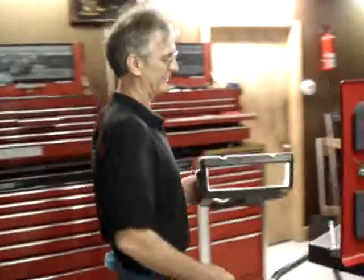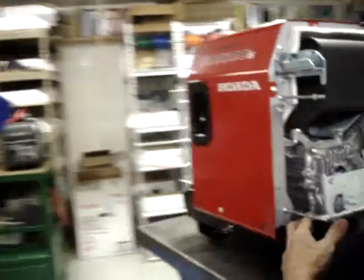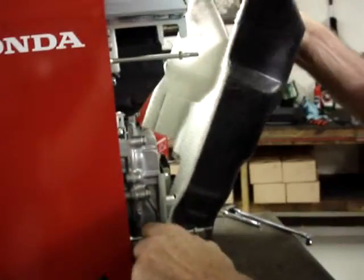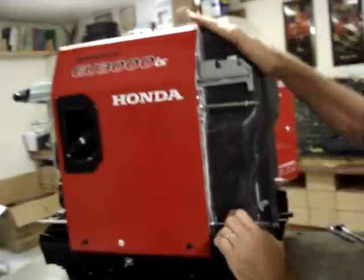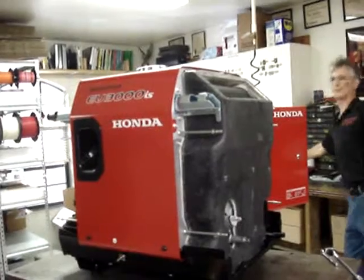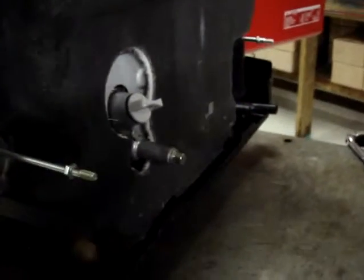The next section will be to put the cabinetry back together. As you remember, on the California model, you've got to spread the heat shield around this motor mount. On the other 48 state model, or other 49 state model, excuse me, you've got to bow both of the bottom sides around the lower motor mount. Shield in place, simply make sure that it's tucked inside these two tabs at the bottom here and fold it up into place.